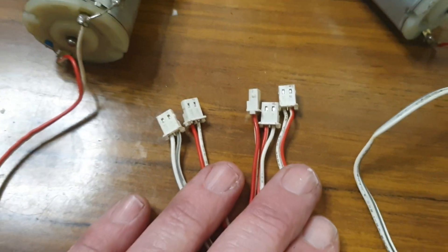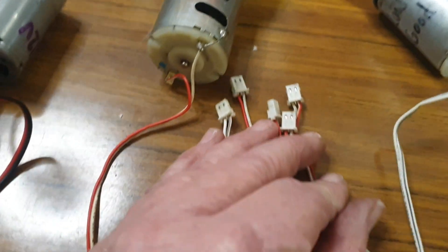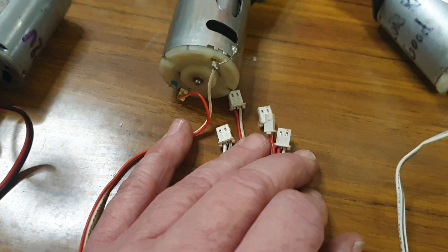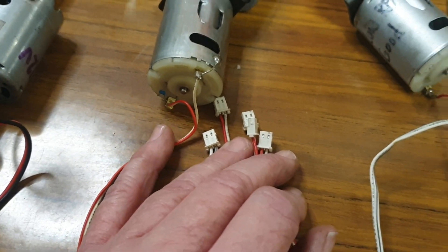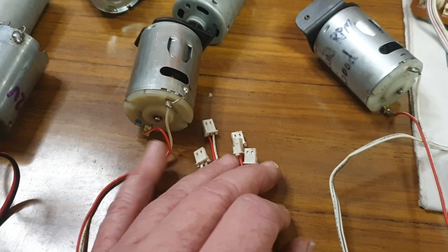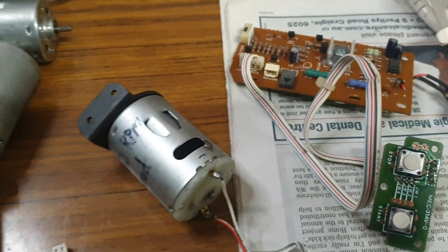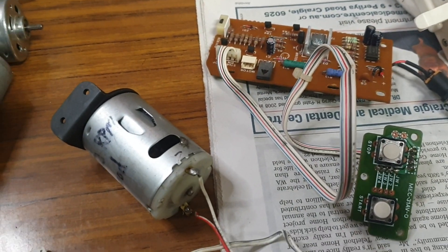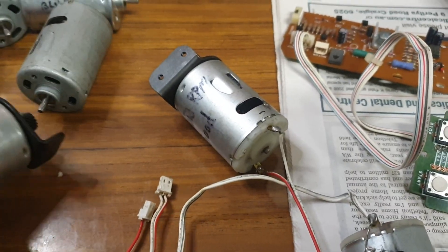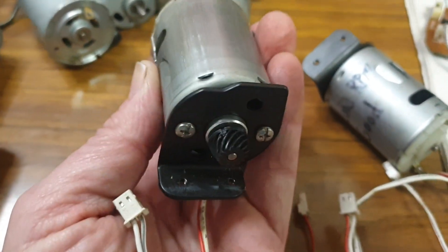My recommendation is that if you're changing to a new motor, you're going to desolder and solder your new wires on. Once you've soldered your new wires on, test it before putting it into the garter carriage. The way you would test it is just have your motor on the table, plug it into your board, and switch it on.